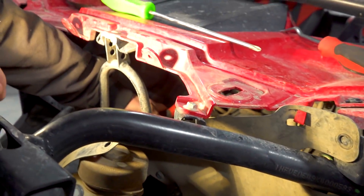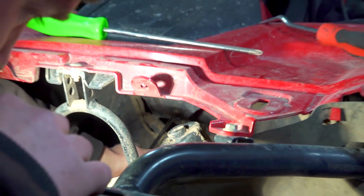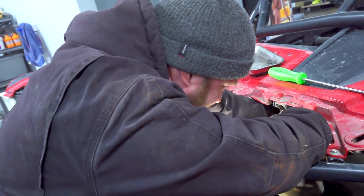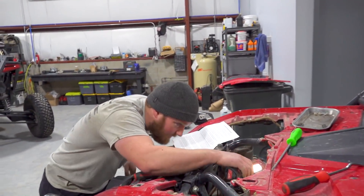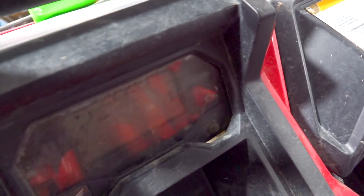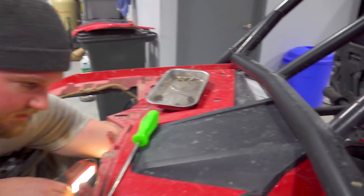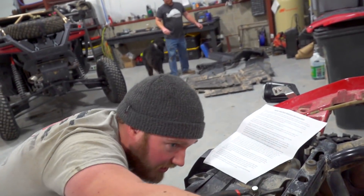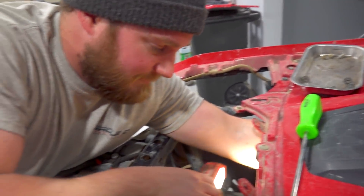We got the hood off, diving deep in here. There are three screws that hold in the factory dash — Matt is working on getting those removed now. There's one; can't really see the others, but they're in a triangular pattern. Once those are out, the factory dash should come out. It moves, but there's still something holding it. Did we miss that in the instructions? Turns out there's another screw up there. We'll get the screw and then we'll be good.